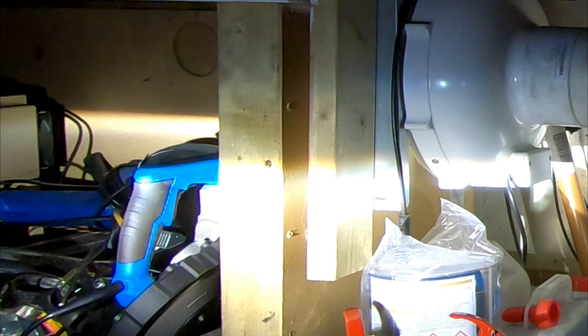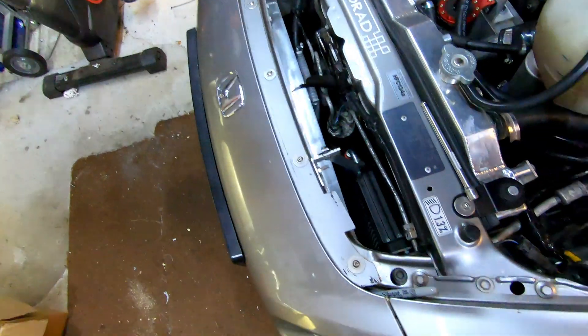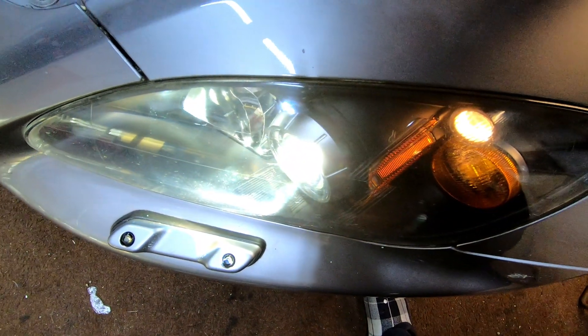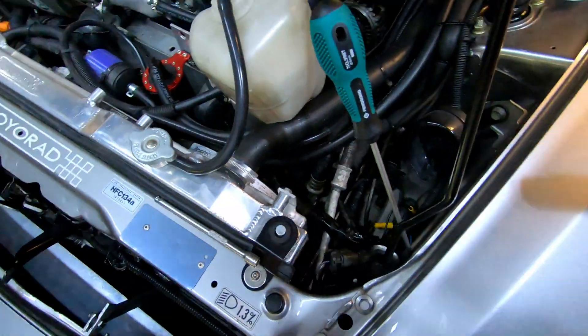You'll see it go back up. The humming, by the way, is the ballast on the HID headlight. So that's how you adjust them. Like I said, to do it properly you should really mark up a wall so you can get the alignment spot on and not dazzle other drivers.